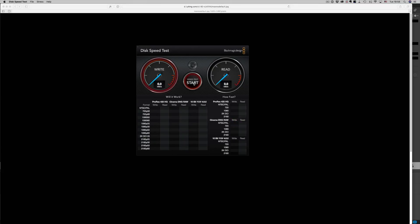Compared to the Drobo 5D, the performance is not that much faster. With the exact same drives, the 5D would give around 170 MBps for write and 200 to 220 MBps for read. The 5D3 would peak higher though, with speeds going up to 400 MBps for writes, but on average write speeds are around 200. If you compare the 5D3 with other systems like Promise's Pegasus on a similar 5-disc RAID 6 array, Drobo's enclosure lags behind — Pegasus can output almost double the speed.